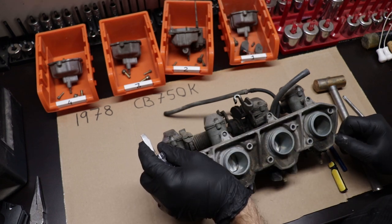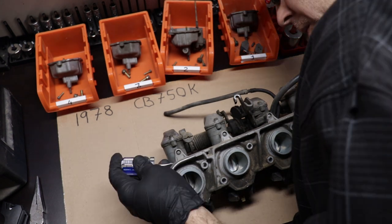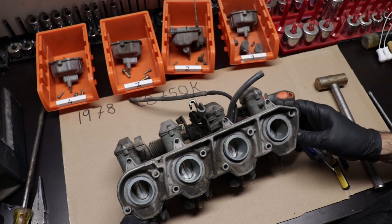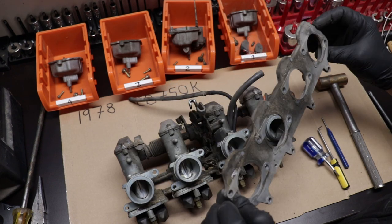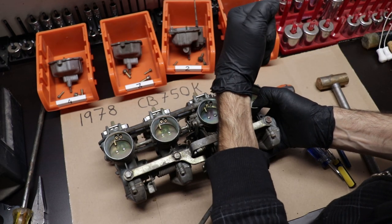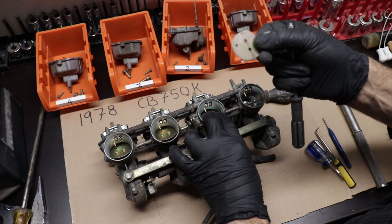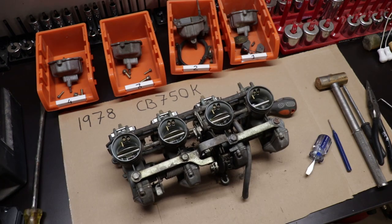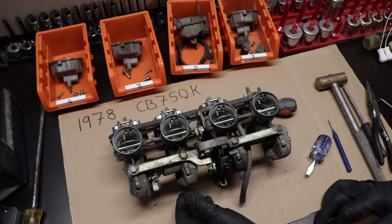Linking it to the rest of the carburetor assembly - that stay plate is pressed onto those four pins that you can see along the top, through those tabs. Once I got it moving off of those it came off pretty easily; it's probably never been removed. Let's remove that choke butterfly valve for carburetor number one. Now it does look like somebody spliced into the fuel line for some reason - fixing that and replacing all of these fuel lines with fresh stuff.